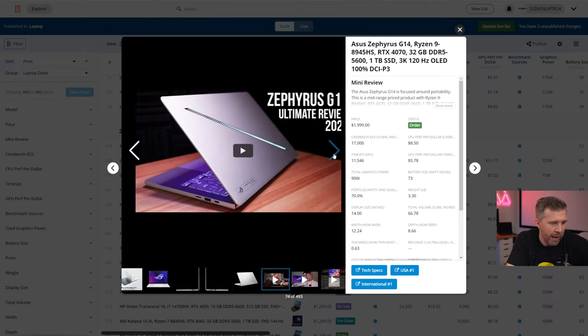I'm just going to leave it at max brightness the whole time. What is this device I put on the screen? This is the Spyder 5 Elite, is what it's called. It's a color checking tool for display calibration and testing. It basically has a sensor on the back of this that will absorb light and then analyze it to tell you what color gamut is being displayed. The software displays certain images and colors, and then the tool will detect if the entire color is being detected or not, and what part or percentage of the color is not there. And then that gives us our overall color range.